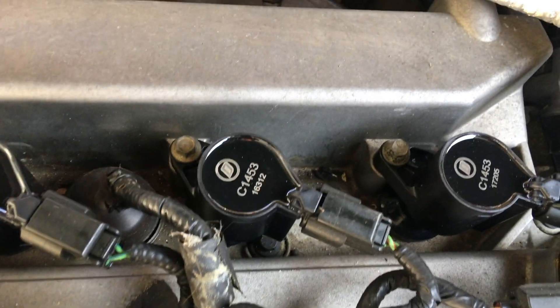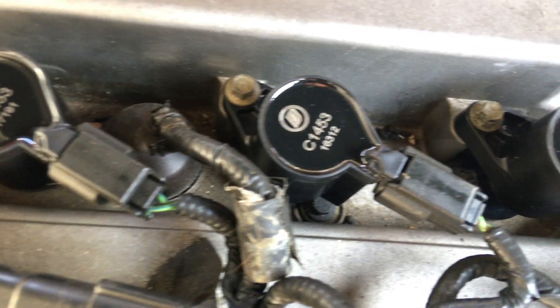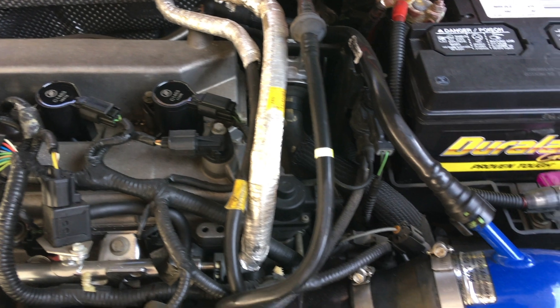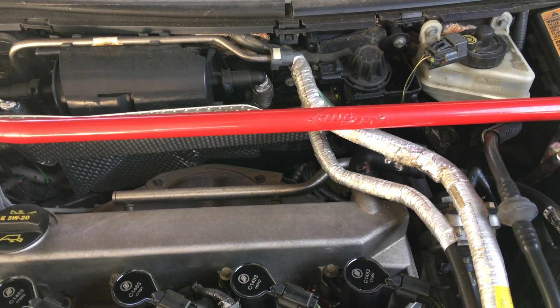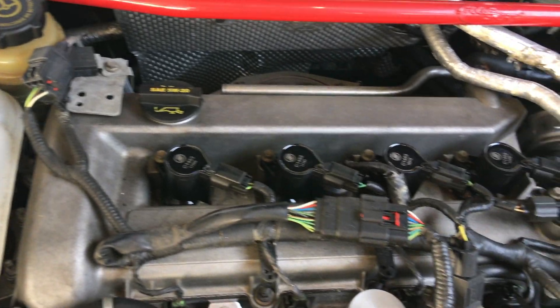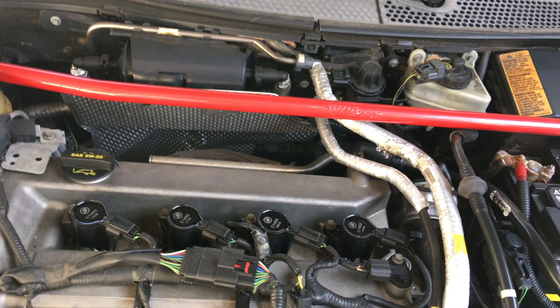All the new plugs are in, and I found an interesting gift over there — while the car was parked, some mice were looking around. Now you can hear the engine is running smoothly again. I guess just one of the coils went out. It ran me about $120 for a four-pack from the parts store, so that has to do the job. This isn't really a daily driver, so it's just much more fun, and I'm starting to convert stuff over to track use more — glad this little project worked.